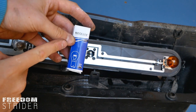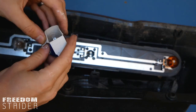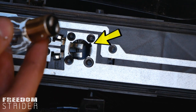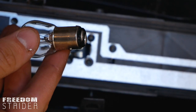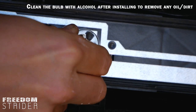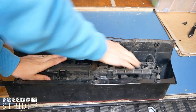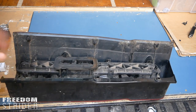I'll leave a link in the description below for the light bulb you'll need. As you can see, there are grooved slots on the bulb socket to accommodate the pins on the side of the bulb. Put that pin in the groove, push down and turn clockwise — and that's the bulb in. Put that back, push that down, and it all goes in.